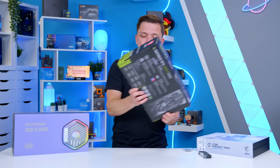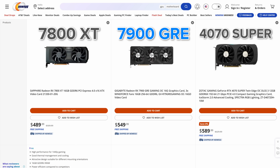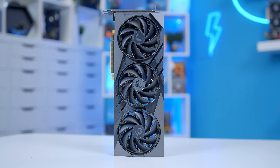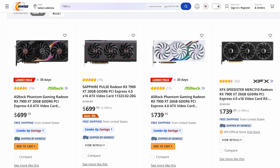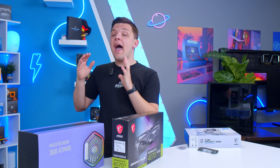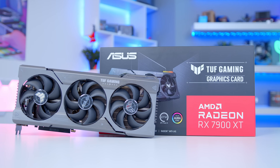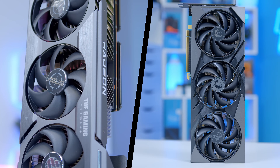As far as graphics goes, I've gone for a 4070 Ti Super in this build. The GPU landscape has changed a lot recently — the new 7900 GRE competes with the RX 7800XT and 4070 Super, and on the Nvidia side we have new Super variants of the 4070, 70Ti and 4080. The 70Ti Super is pretty well positioned; it doesn't have quite as much direct competition from AMD, though their 7900XT with its latest price drop does come close. Personally, I like the advantage that DLSS 3, frame gen, and ray tracing bring on the Nvidia side. AMD will offer a bit more VRAM and better straight rasterization at this price point, but neither is necessarily definitively better — it's great to see so much GPU competition in the market generally.